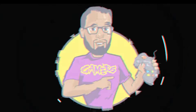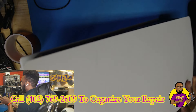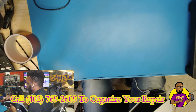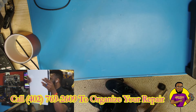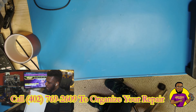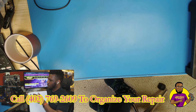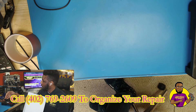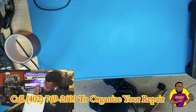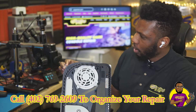Let's go over to the upper cam and see what we got going on. As you guys can see, we have the PS5 — these things are huge, it's actually blocking out a bunch of light. I'm going to open it up. You can see where the disk drive is pointing down. If you have the model without the disk drive, go on this side. We're going to pull the side without the PS logo — push it down and it pops off.